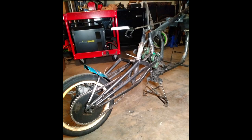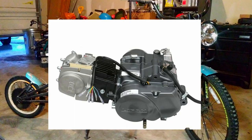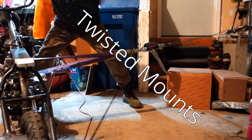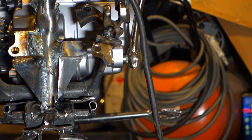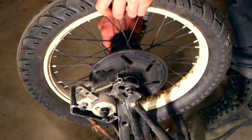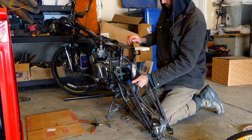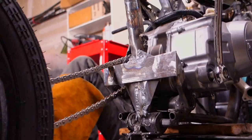The chassis was ready for its new engine. For this, I chose a 140cc 4-speed, and this proved to be too much for the frame. Using strategically placed gussets, strength was scavenged. However, a new issue presented itself in the form of the rear wheel bearings gaining increasing amounts of play. With this discovery, I made the decision to remove my custom swingarm and start from scratch.